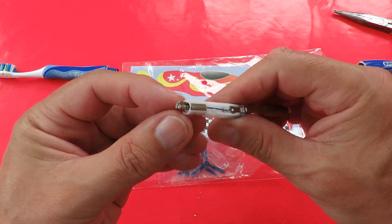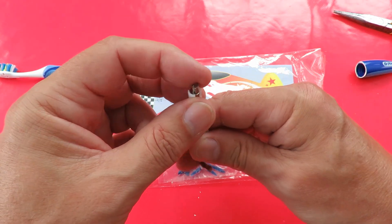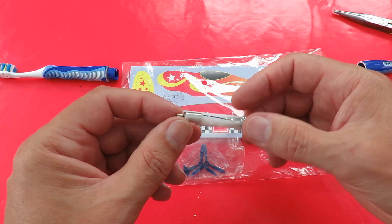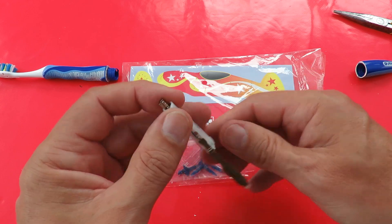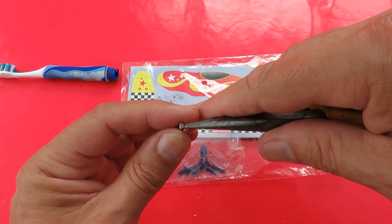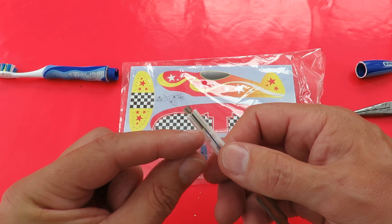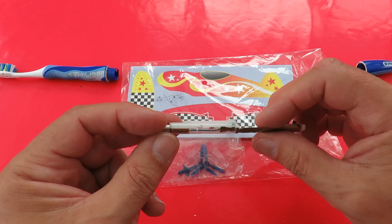So that's the electric motor — you can see it's got that sort of half moon shaped weight that helps it vibrate. One thing I have noticed in recent years, these motors have been getting smaller, probably so they can sell the toothbrushes cheaper. Earlier ones were about another eighth of an inch longer than this, so these are getting very small and very lightweight. And I have a little technique for getting the weights off the end where I tap the pin on the end of the shaft, just tap it through whilst supporting the weight. But quite often it's been bending the shaft because these are very lightweight and they're very thin shafts. So I may have to destroy two or three of these before I get a good motor out of it.